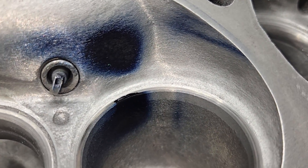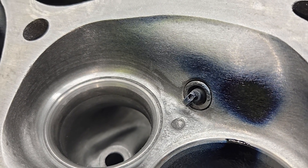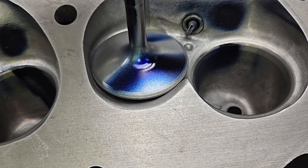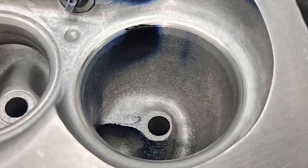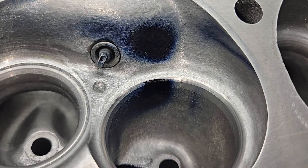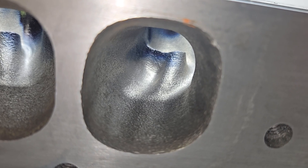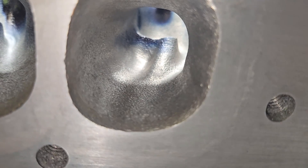It's got some on the cylinder wall side and goes across the chamber with very light speckles. Let's check the bore — it amazes me how close they look. The valve looks very similar to last time. What changed is I put a different texture on the bowl, a slightly different valve job, cartridge-rolled the chamber, and the rest of the port got a very heavy rough texture. You can see where the liquid is hitting that ramp, but it's not the same as before — I personally like this better.